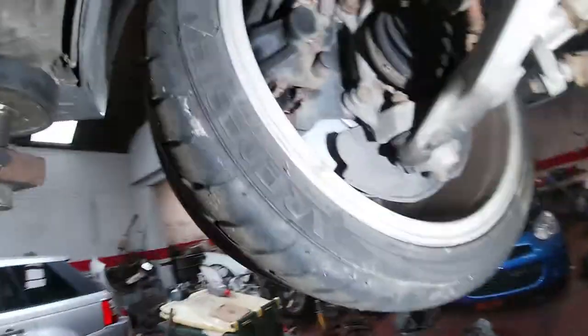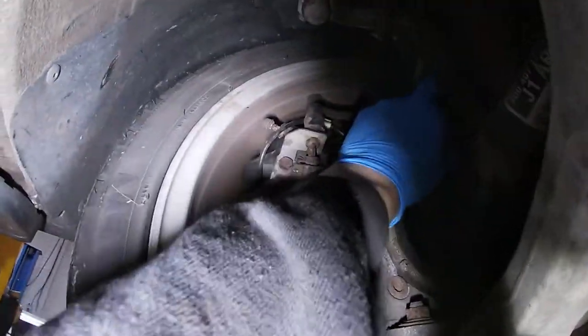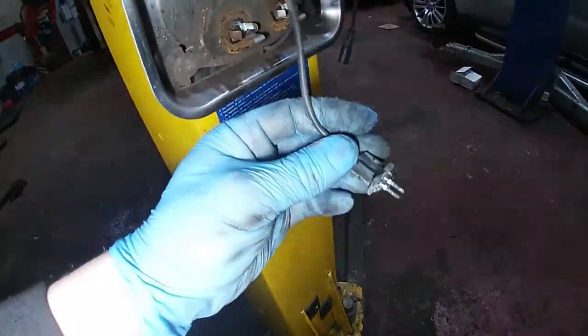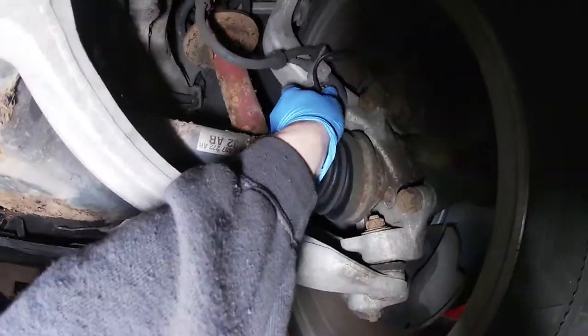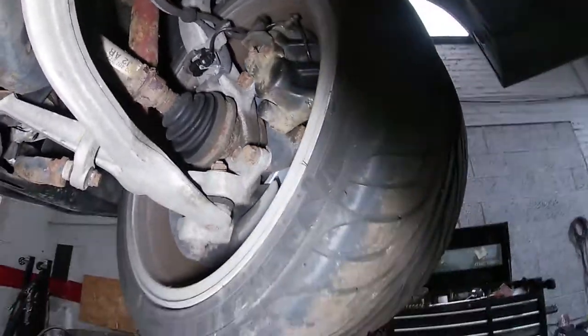We did these front pads and discs as well, and I'm going to have a little play about with these again because the brake pad sensing light is still on. It was these that were rotted off — I don't know if it's these plugs and there's just too much resistance or whatever. It can be quite sensitive to these, but hopefully there's no issues there.